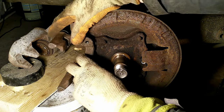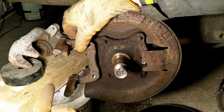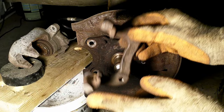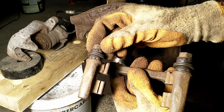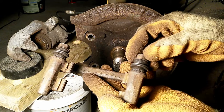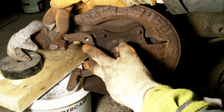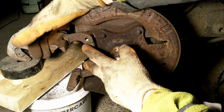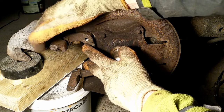I've removed it again. The bracket goes like that — that's the leading edge. The disc spins that direction normally when you go forward, the car travels that direction; that's the rear right. If you look at the leading edge pin, it doesn't really move that much, there isn't much movement. But if you move the trailing edge pin, you can see how quite flimsy it is. That slight movement really gives you a slight degree of freedom so you can twist the caliper a bit and take the brake pads out, then close it back together.